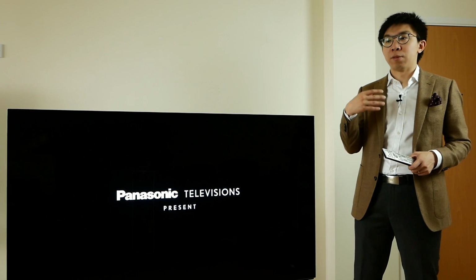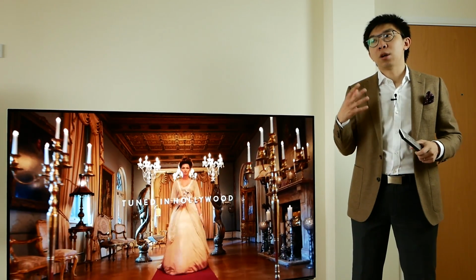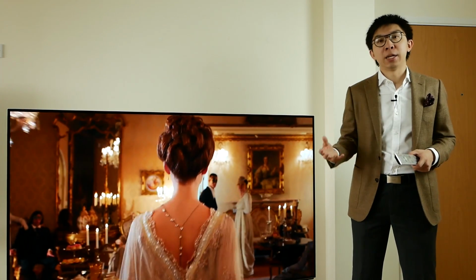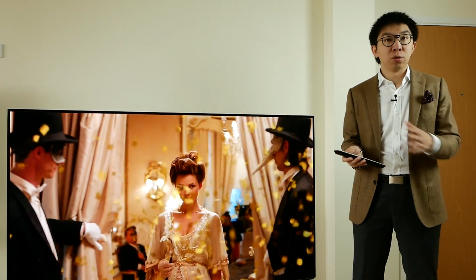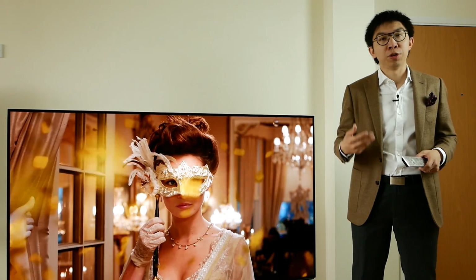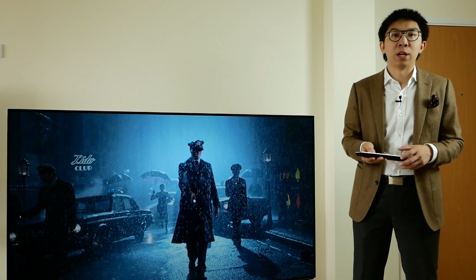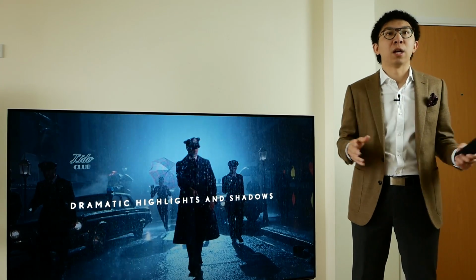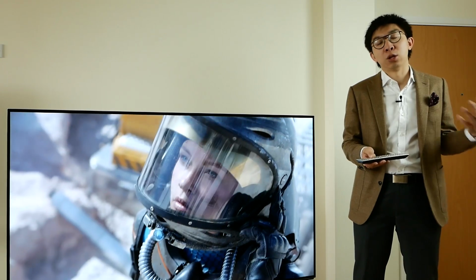So there's a big gap between the 0 cd/m² blacks and the very dark grays that are found in the content itself. In terms of above black handling, the Panasonic EZ1002 is as good as the 2017 OLEDs that I've actually reviewed, which are the LG C7, B7, E7 and W7, and also the Sony A1 OLED as well. All the 2017 sets have superior above black handling compared with 2016 sets and 2015 sets.